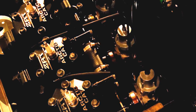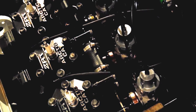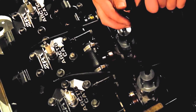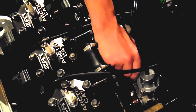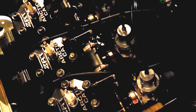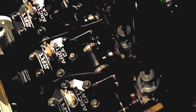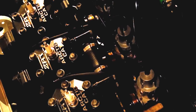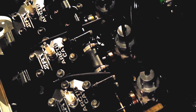Okay, those are all installed. Now we can put our cable in the dash, but before that you gotta adjust the chokes. You'll want about an eighth inch of play at the very end of the lever. Right now there's no play there whatsoever, so just screw them down in. Now you can see it's screwed them in the whole way, and I'd say there's just a little bit more than an eighth inch — that's about good. Just go around and tighten them up, and they sound like they're moving up and down.